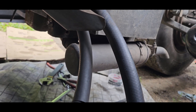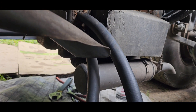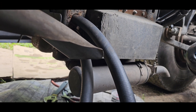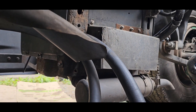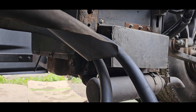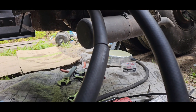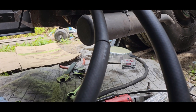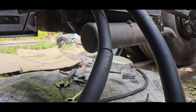What happened was I fixed this one not even a month ago, and we did the regen a few times because the APU did not work, and that caused us to have to do the regen. That's how important the APU is for your truck — for three and a half years we used the truck and never had to do the regen because the APU was always working.